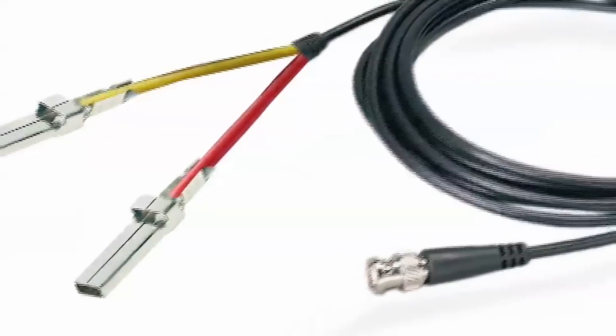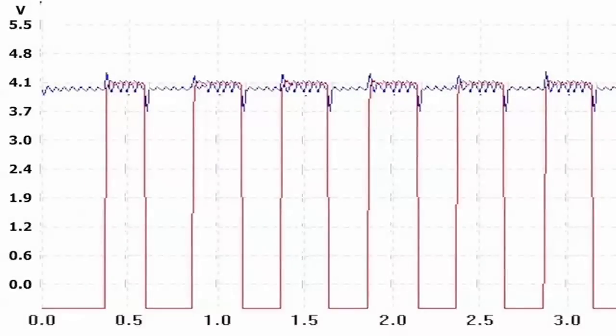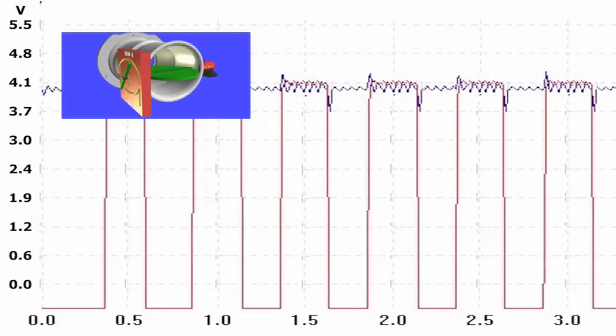The drive-by-wire motor actuator controller creates the duty cycle control signal to act against the spring load. So in slow motion, the pulse pulls open the throttle valve, then it closes again due to the spring action, then the second pulse pulls it open again, and it closes again. But in reality this happens so fast that the throttle valve stays open a specific amount of degrees.